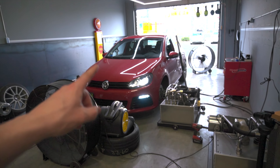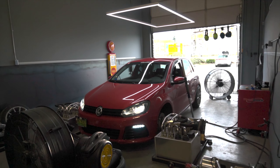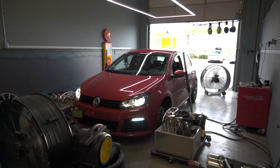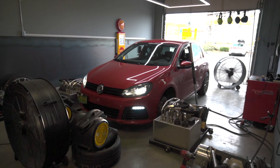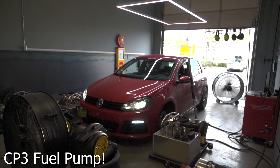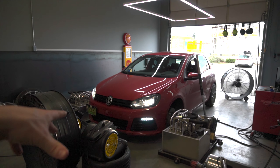We do have a spare CJAA block on standby. For those of you new to the channel, this is my 2011 Mk6 TDI with quite a bit of extensive work done to it. The stuff that really matters today: this is a CJAA block with stock injectors, common rail TDI, a Dark Side Developments GTD 2872 turbo, a BorgWarner intercooler, custom intercooler piping, full three-and-a-half inch stainless steel TIG-welded exhaust all the way back, hooked up for nitrous, ASV delete, EGR delete, DPF delete — everything is fully deleted. We've got a custom intake that picks up in the fog light grille, a four-bar MAP sensor, and we do have bigger injectors to put in the car as well.